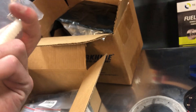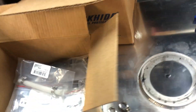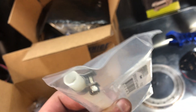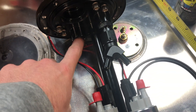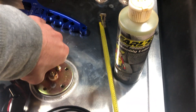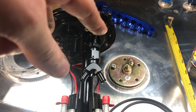Ethanol fuel eats plain rubber hose, so I'm not going to submerge it. I'm using corrugated nylon hose instead since fuel doesn't hurt that stuff. The corrugated lines have their own clamps on them. I also had to go buy bolts because per the fab guide I need 10-32 thread, and I only have 10-24 and 8-32 on hand.